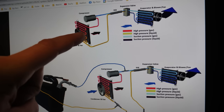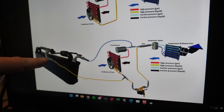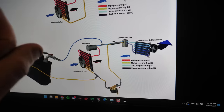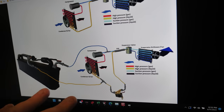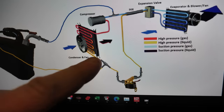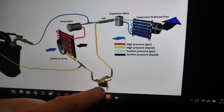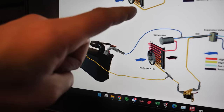Here we have the original air conditioning system as it looks in almost every car with AC. You put two T-fittings into the system, so the interchiller runs parallel to the original evaporator. You also connect one of these solenoids, which allows you to close off the car's air conditioning and send all refrigerant to the interchiller for maximum efficiency — even though I've been running both the car AC and the interchiller together with very good results. High-pressure refrigerant comes out of the condenser, goes to the interchiller via a T, then through the expansion valve. After the interchiller it returns to the compressor.